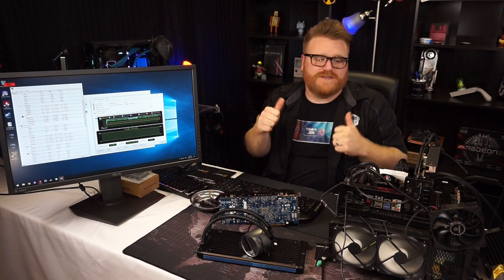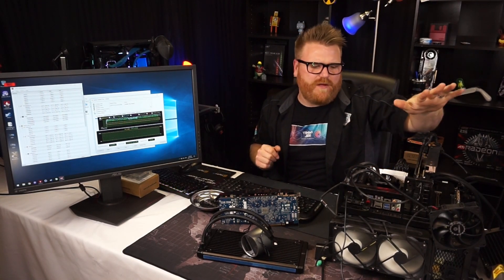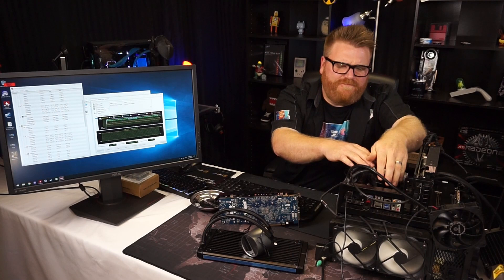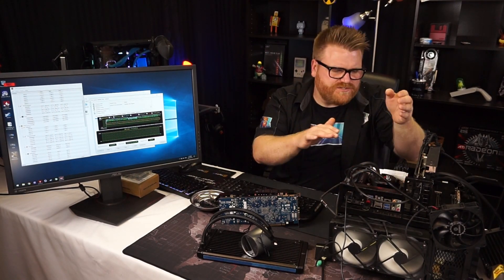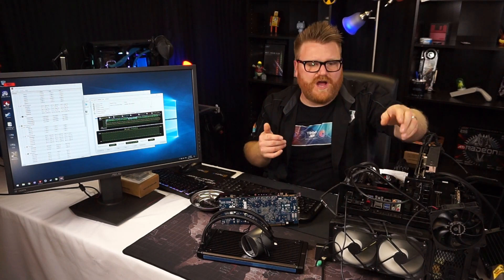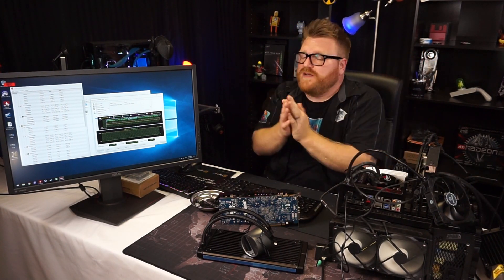Another thing really helping is I don't think we'd get anywhere near these frequencies on any other motherboard — this motherboard is a freaking boss. We're going to switch the AIOs over and see if we can do better than 4.9 gigahertz. It was getting to like 100 degrees for a second — package temperature 101 at one point. But we don't see any throttling. I can feel the little fan pushing air out of the vents through the VRM and actually cooling things down.